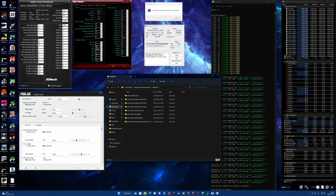And I'm telling you right now, it completely screwed stability. And not in the ways you think. It wasn't like crashing or erroring so quickly. But what was happening was my RAM sticks, I noticed that it was weird. I was like, how can dual rank sticks not draw more power than single rank? Why am I at like 4 watts? My sticks were literally running at like 4 watts, outputting insanely low amounts of bandwidth. And the amount of ECC happening was just so crazy that I couldn't even believe that was the issue.